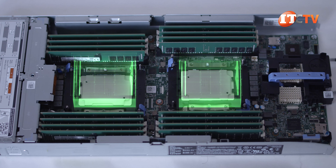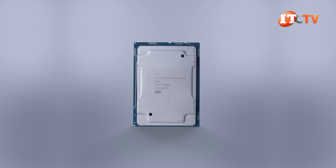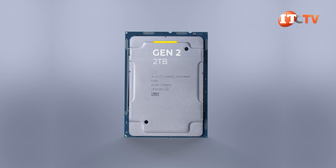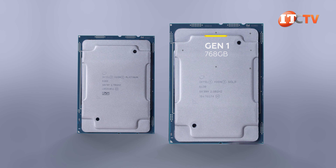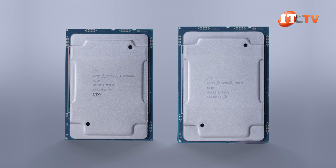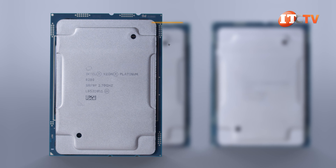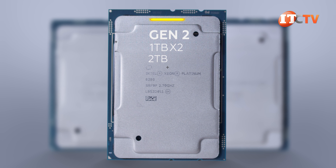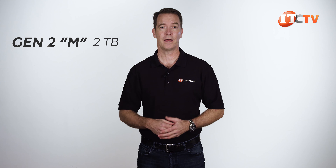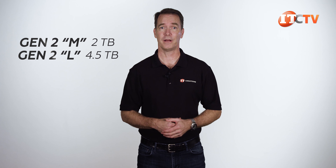Performance on the FC640 is definitely improved with Intel Xeon Scalable Processors, supporting more and faster memory speeds. Using Gen2 Intel Xeon Scalable Processors, you can achieve the top memory capacity of 2TB without purchasing the special CPUs with an M suffix. Standard first-generation Intel Scalable Processors topped out at 768GB per processor, for a grand total of 1.5TB with two processors. If you want to support the full 2TB, you would have to use those M suffix processors from Gen1 supporting 1.5TB each, or use standard second-generation processors that support up to 1TB each and 2TB with dual processors. The second-generation also has new Gen2 M suffix processors which support 2TB each, but even those don't compare to the L processors which support around 4.5TB — though there's no need for them on this platform since it maxes out at 2TB with two processors.